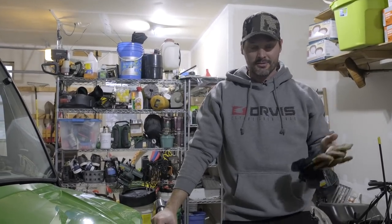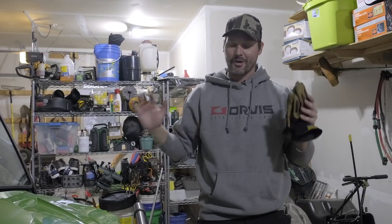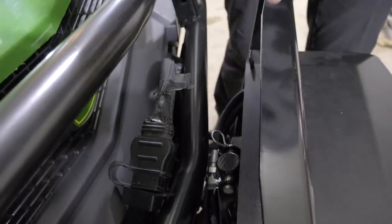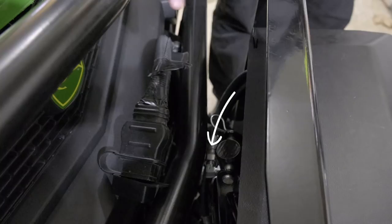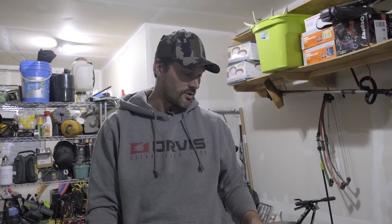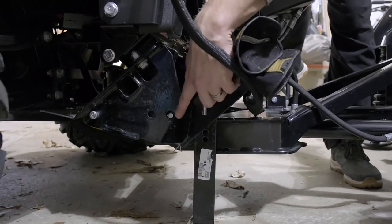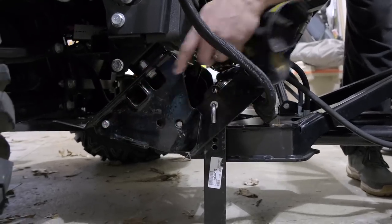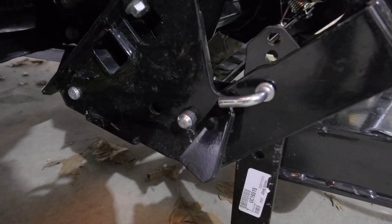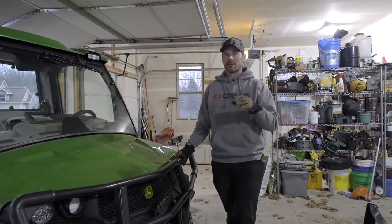Okay, so we've got about 15 minutes — the two of us — a lot of grunt work, a lot of backwards, forwards, shoving, angling, everything else, and then when it kind of just went, it went. So we're going to take it off again and then put it back on — I think it'll go a lot easier this time. A couple things we did: we moved this brush guard back. We actually didn't have it quite in the locked back position, and so it was interfering and making contact right here — that was a problem. And there are different ways you can interpret the steps on the instructions, so it was a matter of figuring out the right interpretation. The technical term for the slots back in here are called headgear slots, and this is a receiver pin back here. So you have your male end that slides in there, forks around the receiver pin, and then this is basically your retainer — it's spring loaded, one on either end, and it pushes out and locks in place.